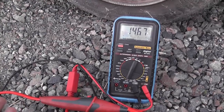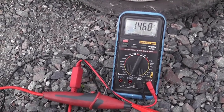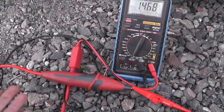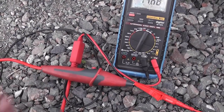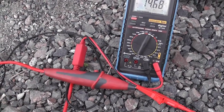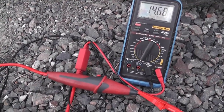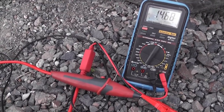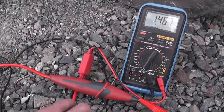So the clutch can't actuate? I would say I know I have enough voltage and no problem with the wiring harness — because we just proved it. It took less than six seconds. The wiring is fine, all the way back to the battery, through the relays. Don't need to look at the wiring diagram. I know the problem has to be from this plug to the clutch somewhere — it's either the clutch or it's the wiring on the clutch. And that's where I need to focus now.